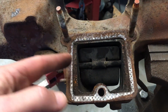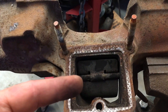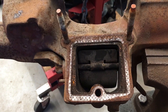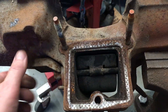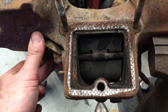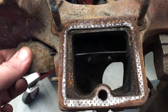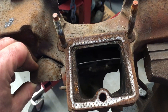Some people delete the plate — they take it out. Well, that does one thing and one thing only: it makes all of the exhaust fumes come up and warm the underside of the intake manifold, which is really not what you want during normal temperature engine operation or in hot weather. You want most of the exhaust diverted away from it. If you live in a mild climate, I recommend you tack this plate in the mostly horizontal position and just leave it like that, because you only need to warm your engine for a minute, so this is really kind of obsolete. However, if you live in cold temperature areas, you have to figure out how to make this operational again, or there are other ways to preheat your intake manifold.